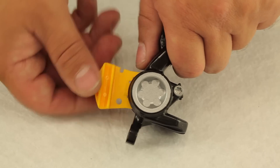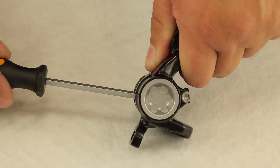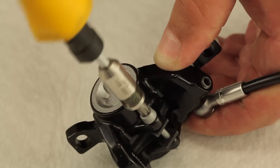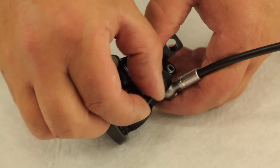First, push the pistons apart using either the transport device or a screwdriver. Take care not to damage the pads should you intend to reuse them. Now loosen and remove the pad fitting screw using a Torx T25 key and take both pads out of the top of the caliper.